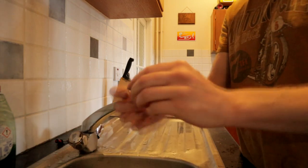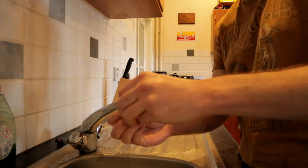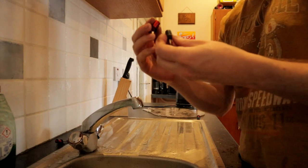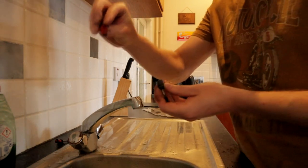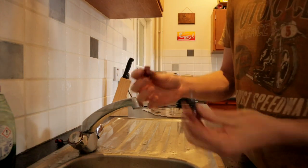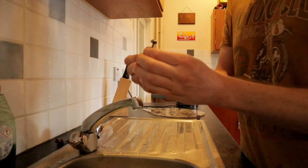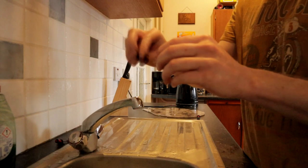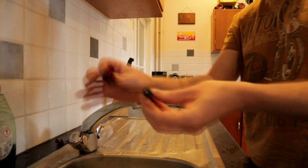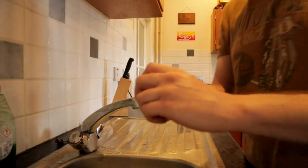Front right shock absorber. Bear in mind, the front felt worse than the back. Oh, yeah, no, there is a very small amount. There we go. Very small amount of oil in there. Pretty dirty, though. Not too bad, but slightly coloured. It should be clear, but it wasn't, so slightly dirty, nothing too bad, but not very much in it. A small splash in it, not going to be enough for any sort of damping, so not great. And we have the front left.